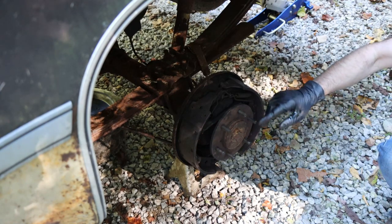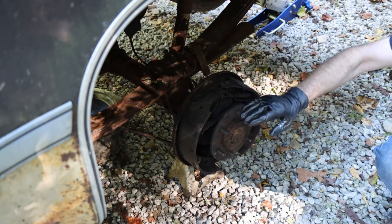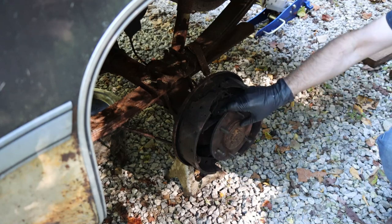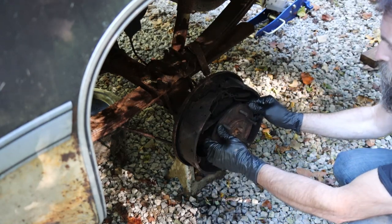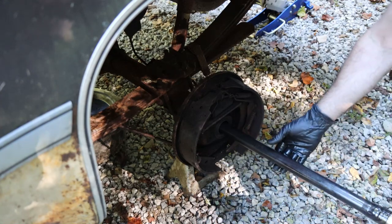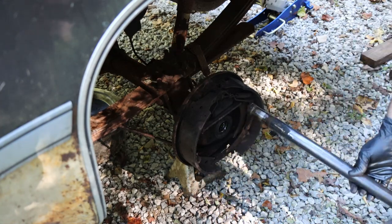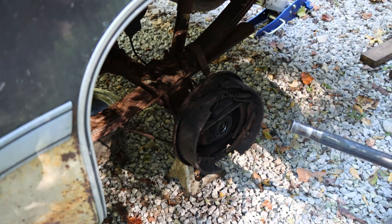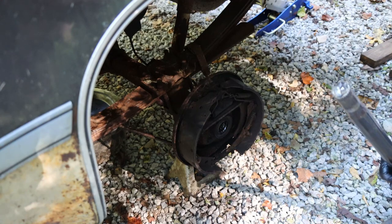They're pretty light duty. Let's pull this axle out here and see what I already know, and that is this axle's busted, but let's get a look at it and see where it did twist. Right where they always twist, right at the end of the diff gear, twisted right in two.